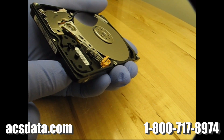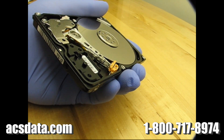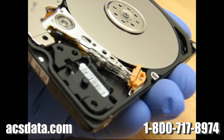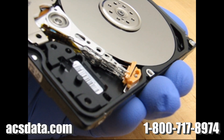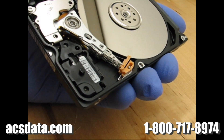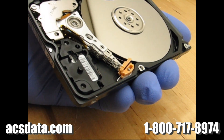The heads themselves are actually just small, tiny little black squares inside there, right on the base of the green read head assembly. I'm not going to be able to get a good view of them. You might be able to see them just to the left of that loading ramp they're on. You can barely see them on my monitor here. Anyway, they shear off quite easily. So we'll go through, put this on the imager, see what we have. We may have to do another head swap, or maybe a couple of head swaps, but we'll get started with the next phase.